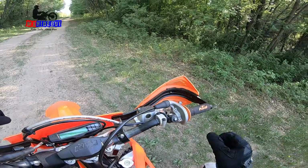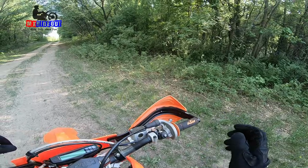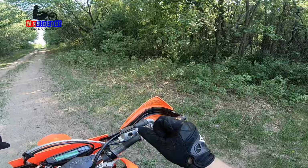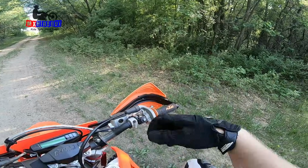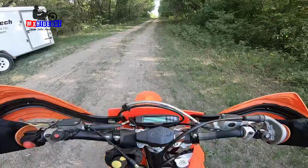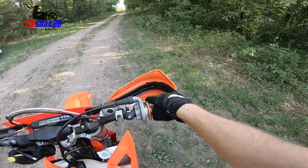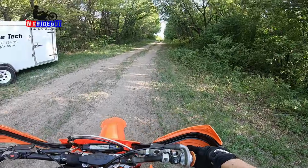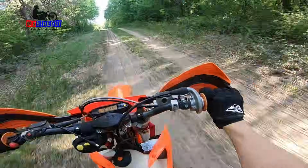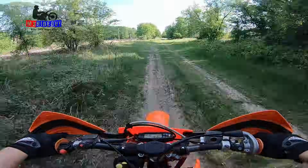Either you get that lean bog when you whack the throttle open and good power revving it out nice and smooth, or if you're richening it up, you get a nice sharp throttle response when whacking it, but then when you rev it out, it sputters. And this is where I'm at right now. I mean, it starts nice and easy. Almost perfect. A little bit of a bog still. That's definitely too rich, so I don't know what to do.